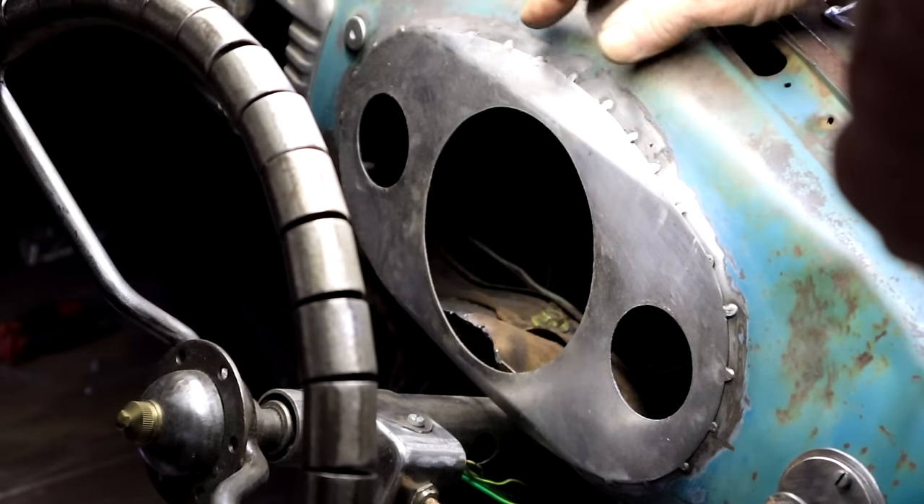Let's try park lights — they should come on even though ignition is off. First click on my headlight switch — oh, awesome! Got my gauges lighting up, very weak in there but it's there. Let's go see if the actual park lights are working. Park lights on — yes, I can see the reflection. Park lights off. I think my mates in the States actually call them running lights, but I could be wrong. Running lights on — yes, they're working, I can see them reflecting against the wall. My number plate lights should also be working — cops here in South Africa are quite anal about number plate lights, so I've got one.